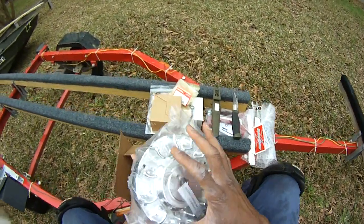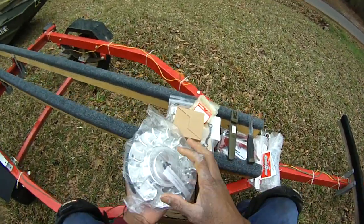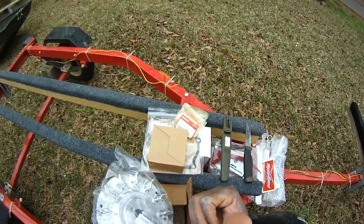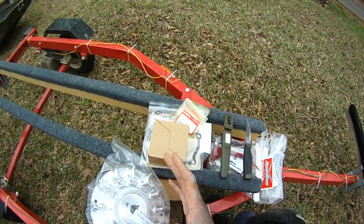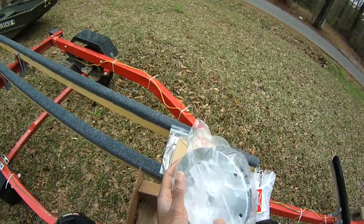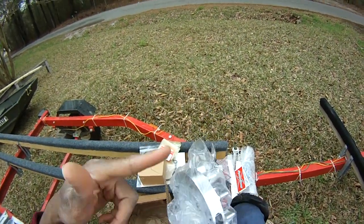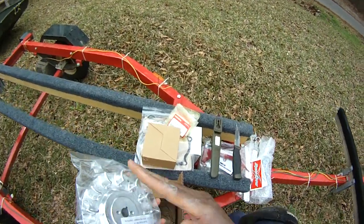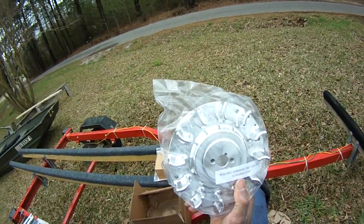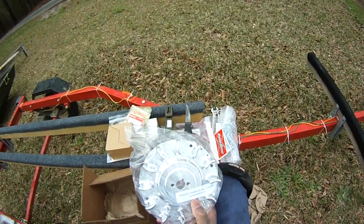Because here's what the flywheel does. The flywheel stores energy. You realize that 4-stroke internal combustion engines are only about 25% efficient. Why? Because they're only producing power 1 out of 4 strokes. The other strokes, it's either getting the burnt gas out or resetting itself. With inertia, you've got a big, heavy piece of metal like this, and the power stroke starts it turning, and it maintains that momentum for the other 3 strokes even though the engine isn't producing power. It's a very cool deal. The stock flywheel is designed for just 3,600 RPM, maybe 3,800.